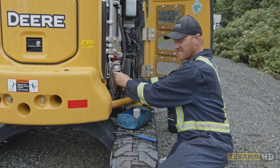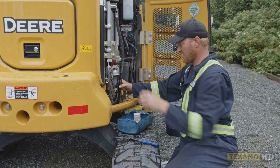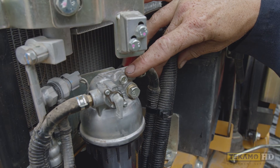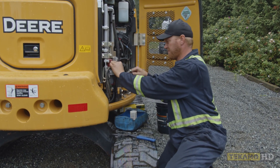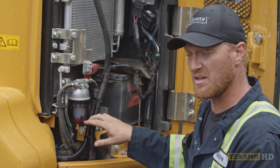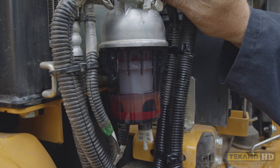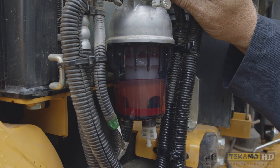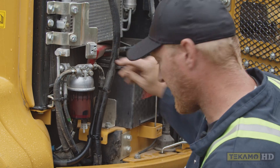I do this housing up only hand tight. Make sure the drain is tight, and you can open the valve back to on. There's a bleed screw right here. I grab a tool — it's a 10 millimeter socket wrench — and we open the bleed screw to allow the fuel to flow in. All you need to do is crack it open a little bit, and right away you'll start seeing fuel flow in and fill the fuel bowl up. I have fuel coming out of the bleed screw now, so I tighten the bleed screw back up.